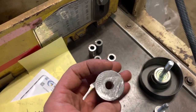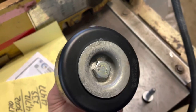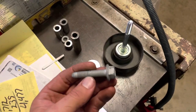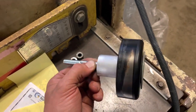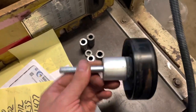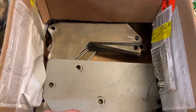This one is solid stock aluminum — I think it's a 1.375 diameter. The reason I had to make this is because I'm going to utilize this factory idler pulley assembly for the LS motor, and this is the original bolt that goes with it. I removed that bolt and put a much longer metric bolt in it, and this spacer will go there. That spaces it out, and this will be where my new belt will ride for the new air compressor location. All this stuff will be included in the kit, with the exception of the idler pulley, because you can reuse the one you're taking off your motor. Anyways, that's the thing I've been waiting on for three weeks to complete the engine assembly on the van.